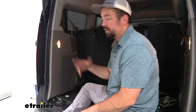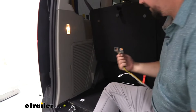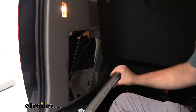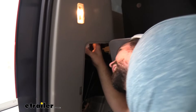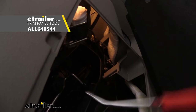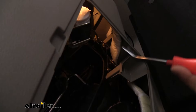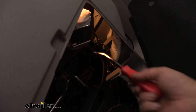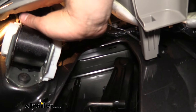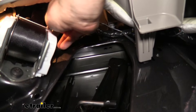We need to plug into our taillight harness. On our harness, the factory-style connectors jump in between the two factory plugs. To gain access, on both the driver's side and passenger side there are panels where your jack and spare tire tools are. The plug is kind of tricky — it's located above the seat belt area. Reach up into that pocket and you'll see a clip. To make it easier, I'm using a trim panel tool to pry it up since it's in a clip. A flathead screwdriver would also work. Getting underneath the plug and prying it up gives us a little more room to work.